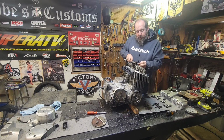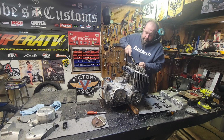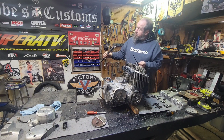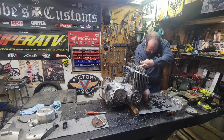So as you see, it's coming apart together. When you have to reassemble it, you got to make sure not to install your gear first. The gear has to come off with the chain and the camshaft all at once. Then when you get it back together, you just get it lined up and all is good. Camshaft. R2. So that definitely is a Honda cam. Yep, sure looks like it. It's got the big lumpy top end. You see how the valve reliefs, they're not round. They open wide and they slam shut. Honda 750 style. Good old stuff. Set this down here.